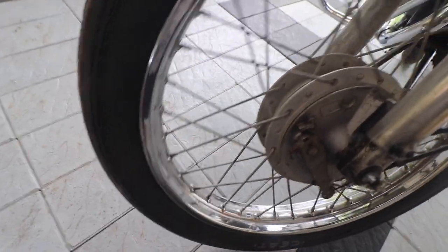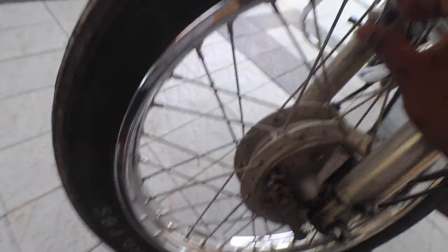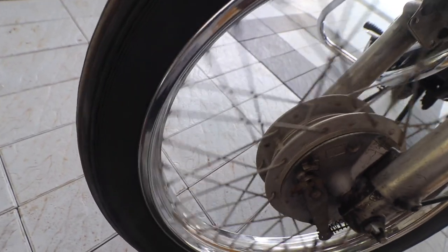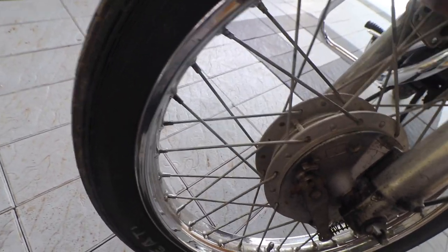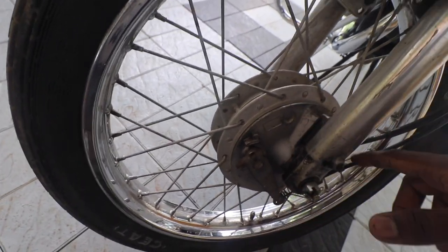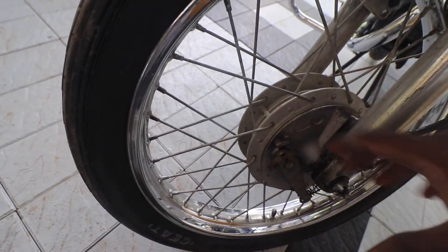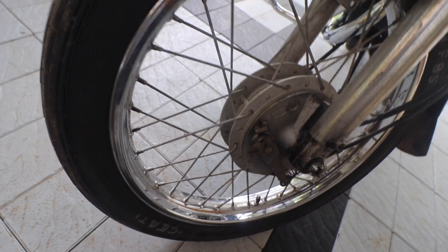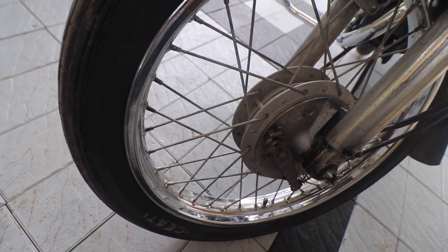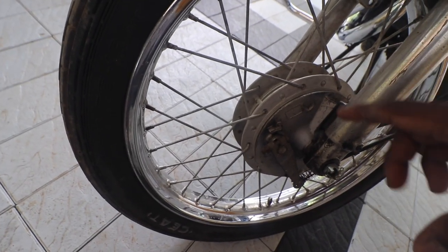The next thing to do is lift the front wheel off the ground, turn the wheel, and make sure it rolls freely without stopping abruptly. If the wheel is stopping abruptly, that would mean it is either slightly warped, there is a bearing problem, or the brake shoes are uneven and catching at uneven points. If that is happening, you will have to address these things once you buy the bike.